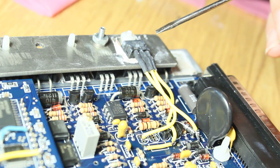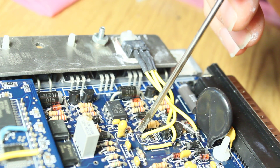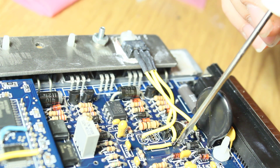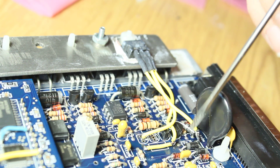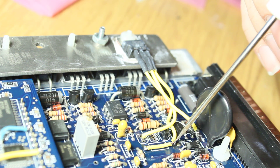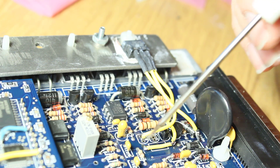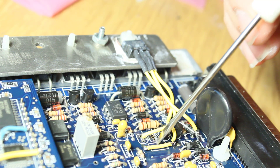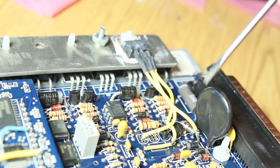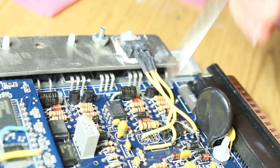For the wiring, down here you wire into Q4 in the middle, then wire over to the right side of R39. I had a little bit of conflicting manuals — one of them kind of implying that you put it in, the Mega Manual strictly saying do not put it in and jumper it. So I've got an email in to DIY Auto-Tune to find out if I really need the resistor, just the short, or maybe neither.